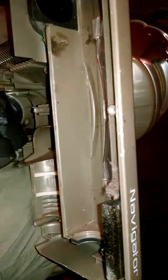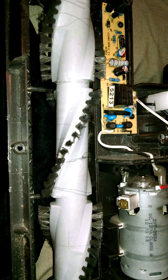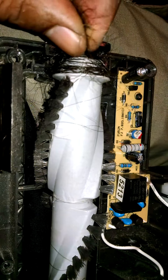You can see the Navigator - it's a very expensive vacuum cleaner. But the brush wasn't turning on it. It was sucking pretty good but the brush wasn't turning. So I just went ahead and took it apart and took a look at it. It looks like a little bit of hair, and this kind of stuff keeps it from spinning - it's just stuck down in the spin hole here.